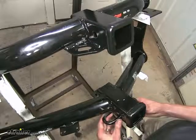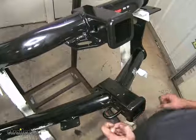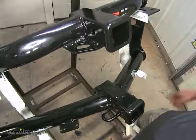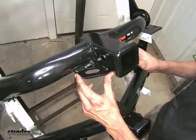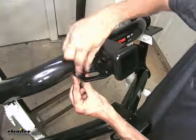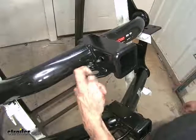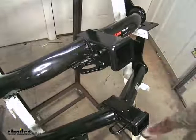The Draw-Tight hitch has these nice, round, tubular safety chain loops — real easy to use. Even with small diameter hooks, they'll clip on real easy all the way around it. Whereas the Curt here has this plate steel construction welded on the back of it, and it gets a little tight on the sides, so if you have a smaller diameter safety chain, they may be a little bit more difficult to insert, but most every chain should still be able to get in there just fine.